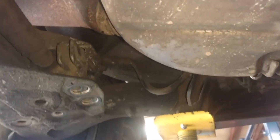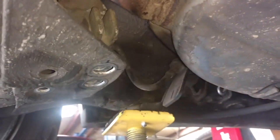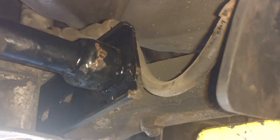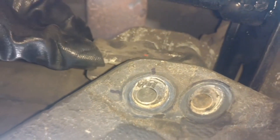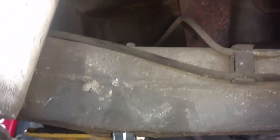Sometimes you may have to move your exhaust out of the way. I got one hanger that was already broke, so I may have to take this other hanger loose and maybe the tailpipe — but let's see what happens first. I got it started, maneuvered it up in there. Tap the end of it with a hammer. You see the paint markings — I have it lined up with the hole. I'm gonna put these two bolts in, then re-secure this mount here on the back.